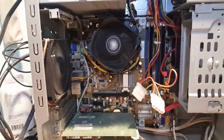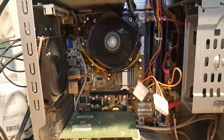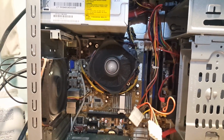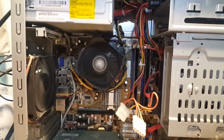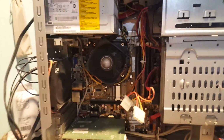I mean, duh. As old as this is and for as cheap as you can get this stuff for, the memory is going so cheap on eBay. Like the sellers are practically paying you to take it off their hands. It's almost that cheap. Not that cheap. I mean, $20 will easily get you 8 gigs, 2 gig sticks of DDR2, which is what this is. Ideally, though, if you want to run a Xeon, look for a DDR3 board.